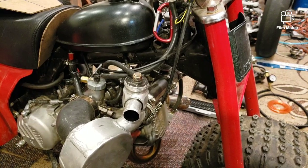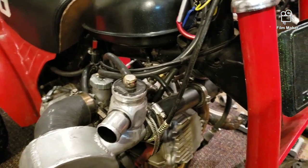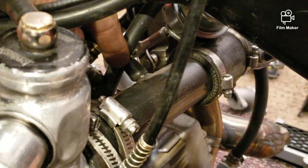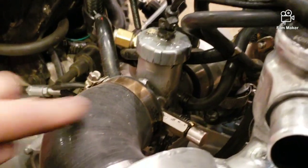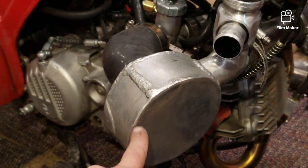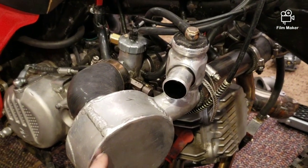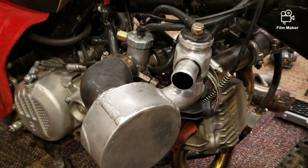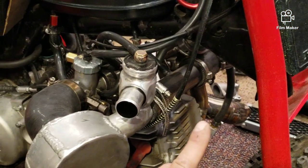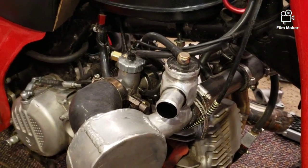If you don't know, go watch the three videos so you know. My pitot tube on this current setup — which will change, this is all still rough — is right here coming out of the charge pipe, and that goes to the vent for the float bowl or fuel bowl. This is what gives the motor the initial gulp of air it would normally receive if it were naturally aspirated, because the turbo restricts a lot of airflow coming in.